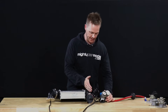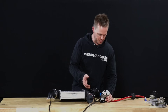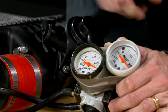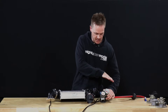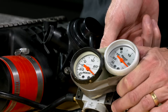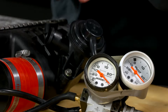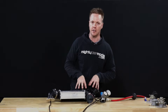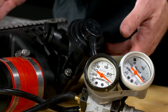Now I can hear some leaking coming from the outlet of the valve. We are at 22 psi. I'm going to keep going and see what else we get. Now what you're going to notice is the more I crank up the system pressure, the less this needle's going to move, because this is basically the pressure at the valve right now. 30 psi going in — we've only got 24 psi here. No matter how much I feed into there, we cannot increase the intercooler pressure any further because it's basically flying out of there.